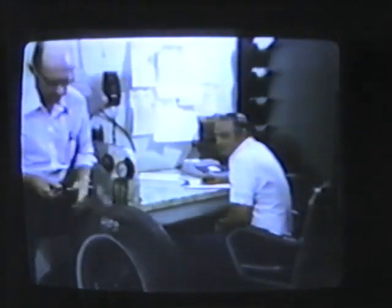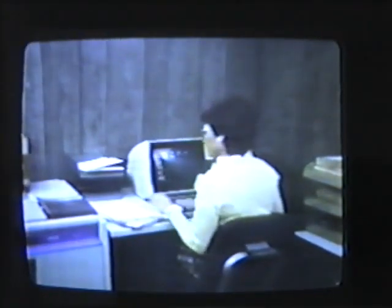Test tires are periodically examined. At regular intervals, they are visually inspected, physically measured, and they may also be subjected to a non-destructive laser holography probe to study interior stress variables. Accumulated in computer data banks, the resulting data is shared with the company's research and development centers throughout the world.